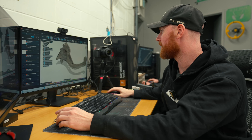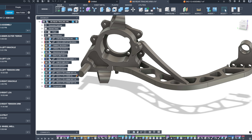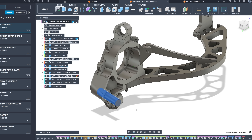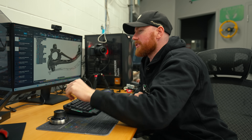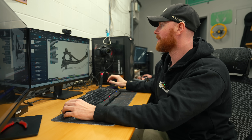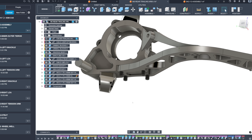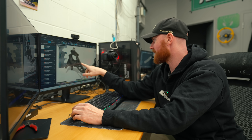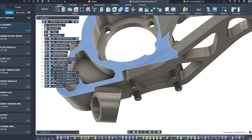This is the outline of the M3 trailing arm, and if I hide that, this is kind of the Minecraft version. I basically wanted to go with a full billet knuckle that connects the shock — upper and lower — and he still runs it divorced, so he's going to be running the spring on the upper control arm and the shock on this part here. The knuckle's integrity has to be able to sustain the weight of the vehicle being applied to the upper control arm, just like factory. So we went with a fairly large aluminum design that is going to be quite light and really, really strong. The trailing arm portion itself is separate — it's going to mechanically constrain itself to the knuckle using these alignment nodes basically coming off of the billet knuckle.